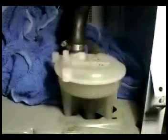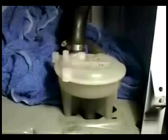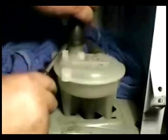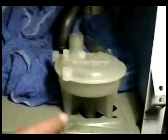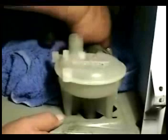Before you remove the hoses from the pump, take a towel and put it under the pump and the hoses to catch any water leaks. Remove the clamp and use a flat screwdriver to remove the tub to pump hose. Next, loosen up the clamp and remove the drain hose.